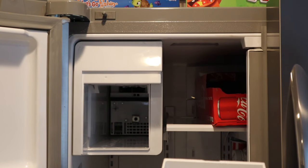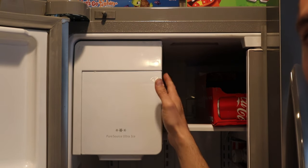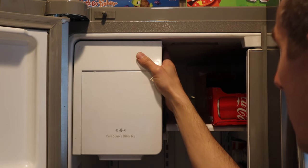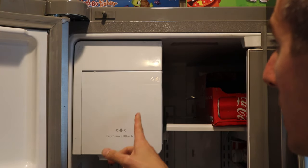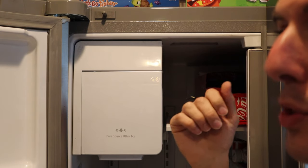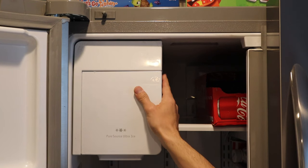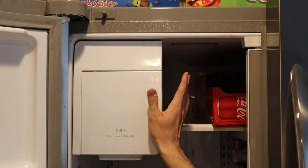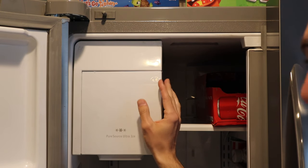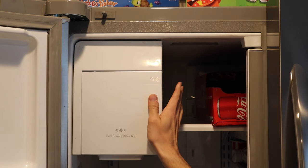Let's see what we got. Here's the tray — last step, slide it in. It looks like it's there, everything's back together. Make sure all your connections are connected — obviously if the connection's not connected it ain't going to work. Make sure you get all the old ice and the old condensation from inside there so it doesn't just freeze up again. If you think about it, water inside the refrigerator shouldn't freeze because it never hits 32, so obviously there's something else going on in here. I'm going to fire this refrigerator back up and get back to you and let you guys know if it worked.